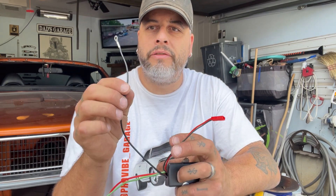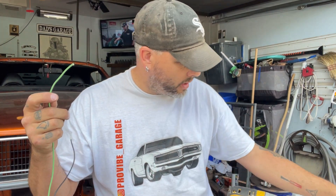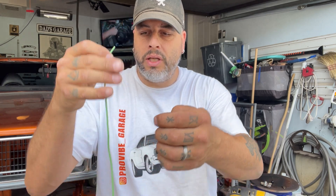Pretty self-explanatory — this will hook up to the wire coming out of the actuators, bring it through the firewall somewhere under the dash. You're going to find a ground, a constant power source, and then with the provided wire splice you're going to attach that to the light green wire coming out of or going to the dimmer switch. That'll be another time for me — I don't have a battery but I should get one soon so I can test things and finish wiring the stereo. Pretty straightforward project if you're looking to do the same kind of thing. Topher McGinnis — the headlight motor man — give him a call. I will post a link to his website in the description.